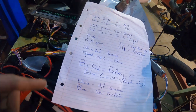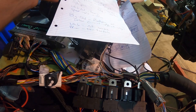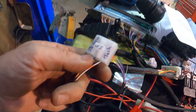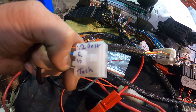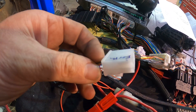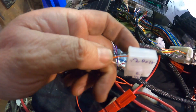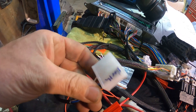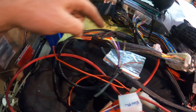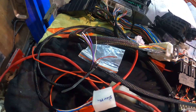Check light, we've got a tachometer — tacho over here also. So I've got a tacho popping out here, a speed output popping out here, a 12-volt, and an earth — and they are for a Dakota Digital box that can be plugged in under here. This isn't all taped up too much; you can still undo it and run wires or remove wires around the loom.